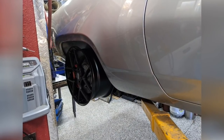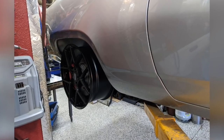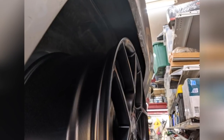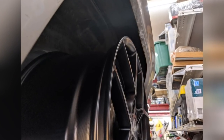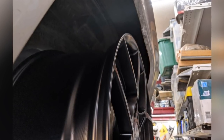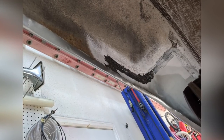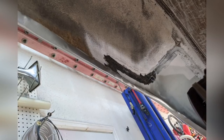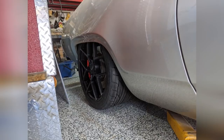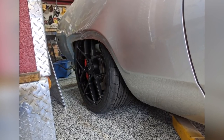Next I tested with actual wheels and tires to make sure I have full clearance. The wheels I've decided on are a 20 by 10 American Racing — a high positive offset wheel to make enough clearance for this Tesla subframe. With that fender lip there, it looked like I needed to roll it. I used my buddy's fender roller tool from Eastwood — you mount it to the hub and roll it back and forth, heating up the paint so you don't crack it. Got it folded in and now it tucks in real nice.